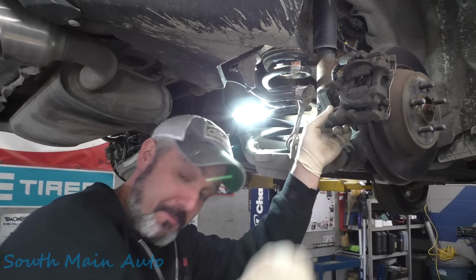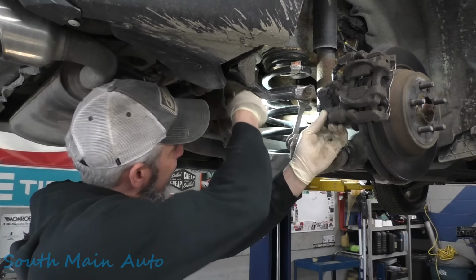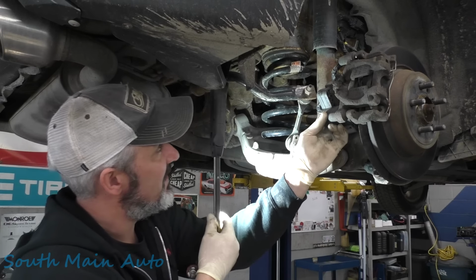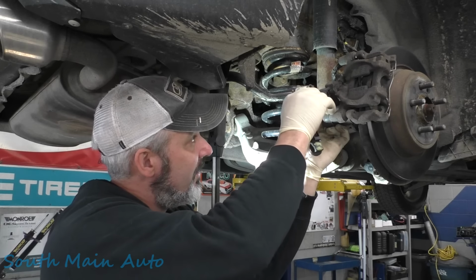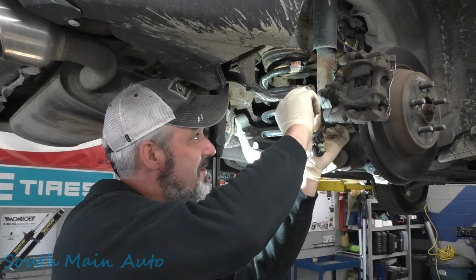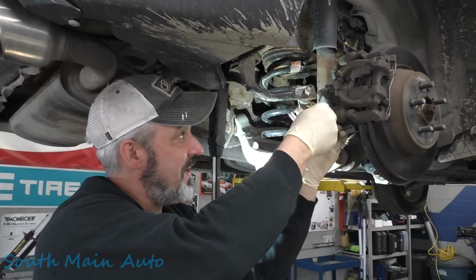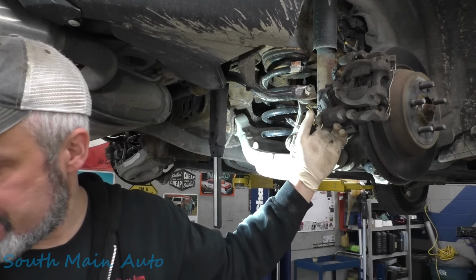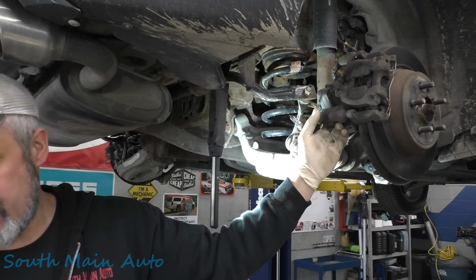So we have this unplugged. I'm going to substitute the load here. It's just a 4 amp test light. Just going to very lightly front probe it here. And then we're going to rerun this test and see, does it light the test light? Because if it does, then we know a couple things without doing a lot of looking. So I'm rerunning the test right now.